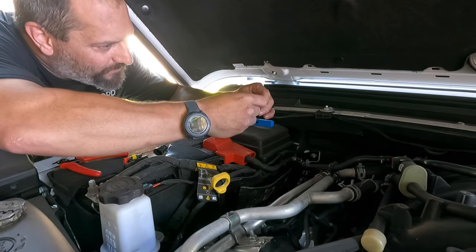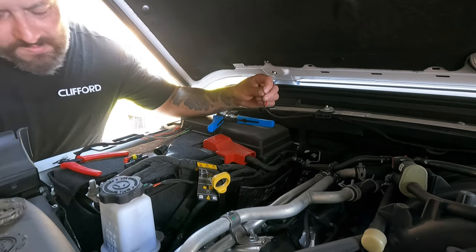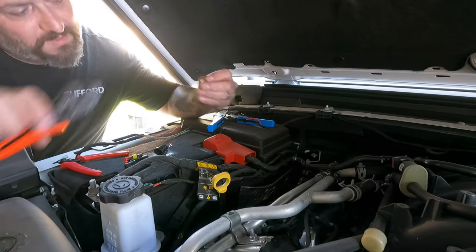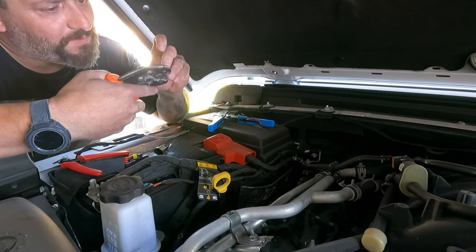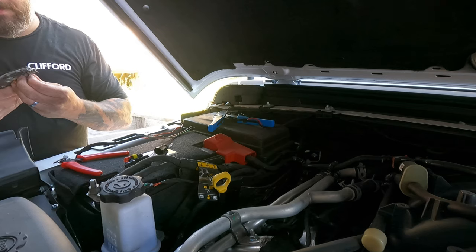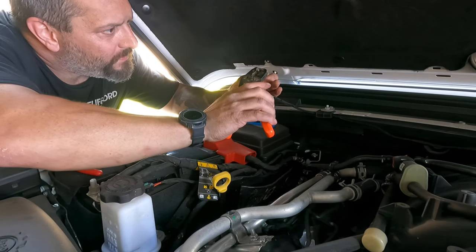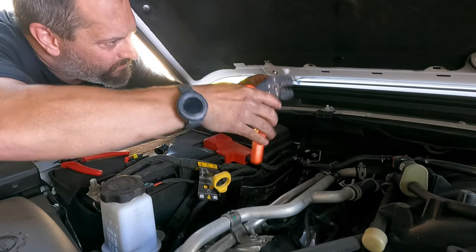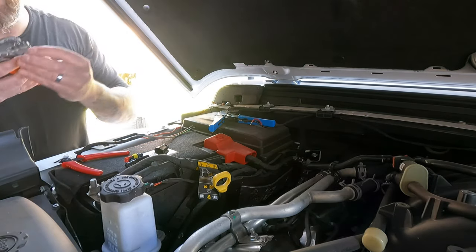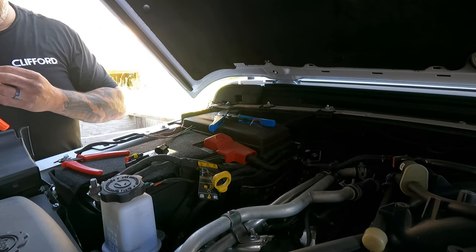What we're doing now is I have these wonderful plugs. I want to be able to have these so when I go to take them apart, if I ever have to replace one, I can turn around, take off that light itself, and away you go. So I'm making a harness with such a connector on it, because these didn't come with plug and play connectors or harness.